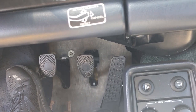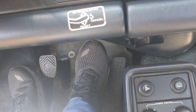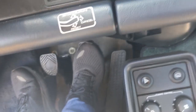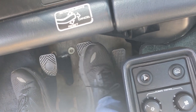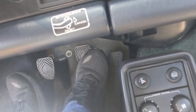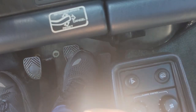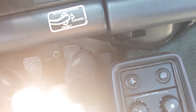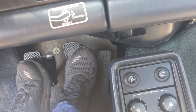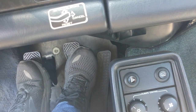The other thing while I'm adjusting the pedals is I want to be able to hit the brakes and the gas pedal at the same time. But I really can't do that with this car without really tweaking my ankle. From here to here, it's really tough to hit the gas pedal. So ideally I can change that so the gas pedal is a little closer and the brake pedal is a little further. We'll adjust all three pedals to get the best driving experience. None of this stuff is in the manual - this is kind of stuff that Ian has showed me on improving your driving, and a lot of it has to do with your pedal setup.